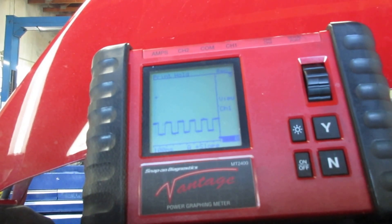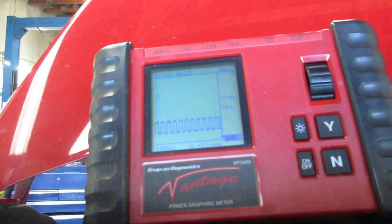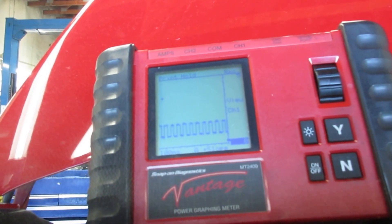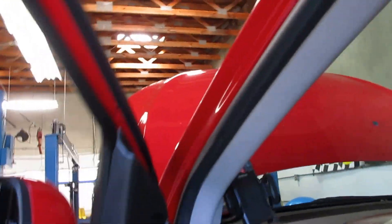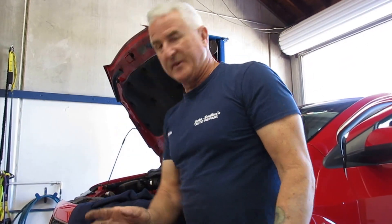At a certain RPM range, we'll pick it up again and see what we get if it does it again. Okay, now it's working smoothly. But the reason I want to make these videos is that shows you beyond a reasonable doubt. I compared it with a signal on the passenger front — the passenger front signal stayed great the whole time. The driver's front, the ABS module starts clicking and ratcheting every time the signal breaks up.